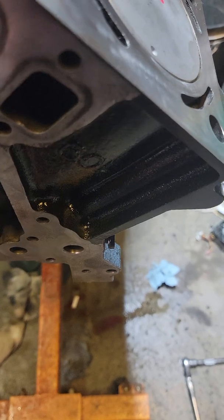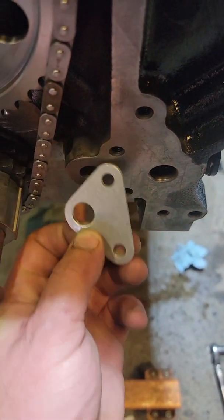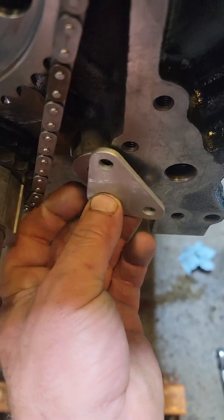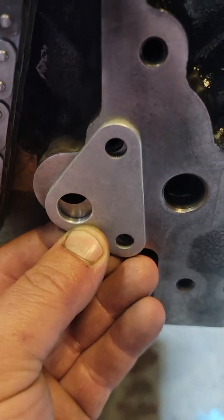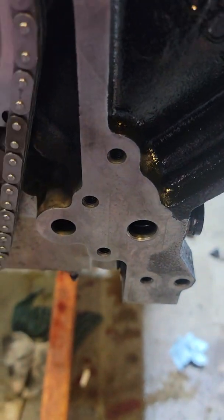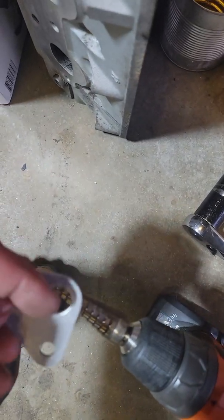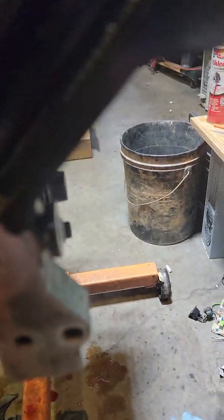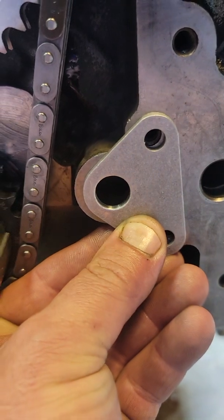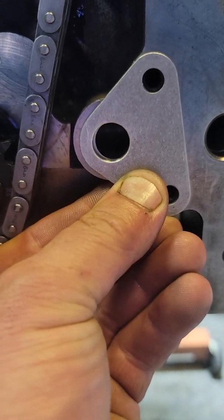That would be this one here, and these are directional. As you can see, when it goes on it does need to line up correctly — if you put it on the other direction things don't line up right, and you're going to have trouble with the oil hole; it's not going to get to the galley properly. I took a unibit and deburred the inside of this hole and enlarged it ever so slightly just to make sure it is the exact same size. As you can see, it's going to be a perfect fit.